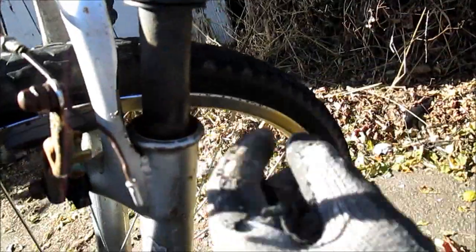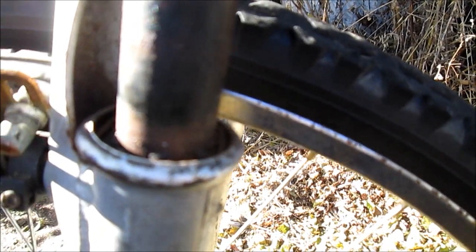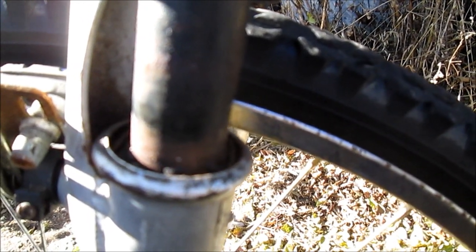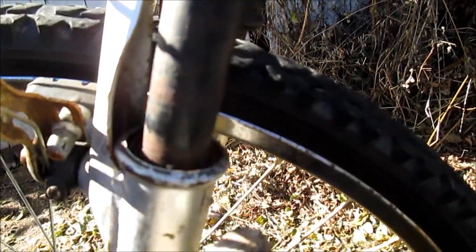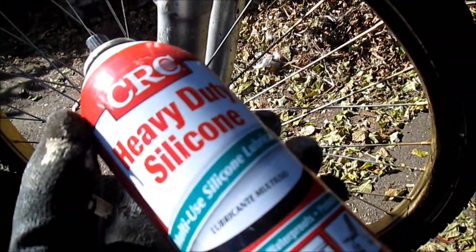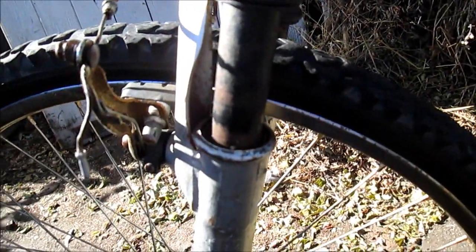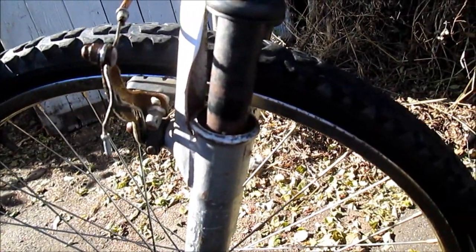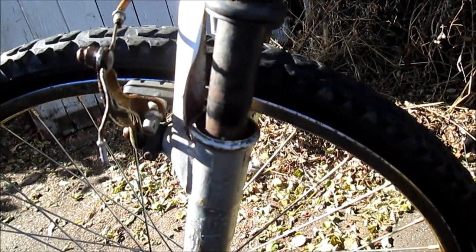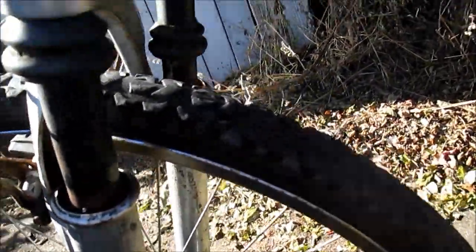These have little lips and they keep them inside here. They look pretty rusted. What I should do is hit that with a little steel wool so that this rust doesn't affect the seals inside. I've got my heavy duty silicone to spray in here. The thing you've got to watch out for is if these shocks are flat — if they're flat when you get them it could be harder to get going. These apparently are flat, so I think I've got a chance to bring them back to life.